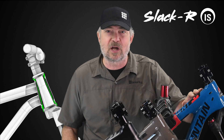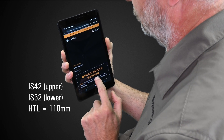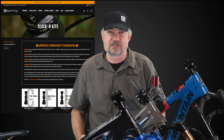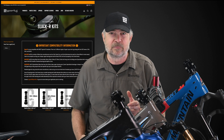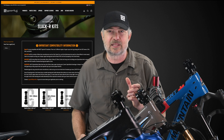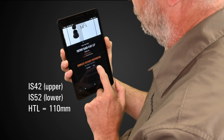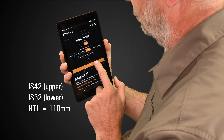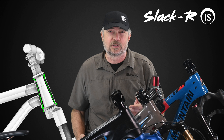Let me demonstrate by ordering a slacker for this Rocky Mountain frame. We've measured the top bearing as 42 millimeters, the bottom bearing is 52 millimeters, and the head tube length is 110. The selector tool on the website will offer all kits that meet your specifications. Note that if you have a head tube length right on the edge of the recommended kit range, installation is more fiddly. The easiest installs come from kits where your head tube length is somewhere in the middle of the kit range. When you make your choice, you can add the kit to your cart. Note that the IS slacker kit reuses your bearings — if your bearings are poor, you should also order replacements, as they are not included in the IS slacker kit.